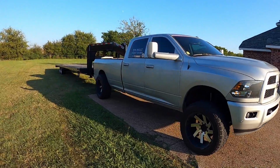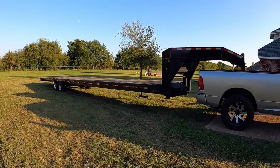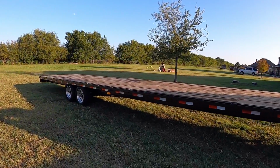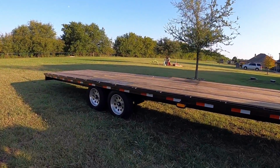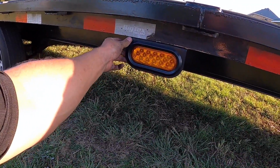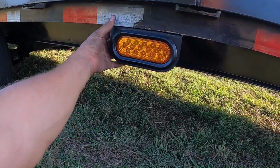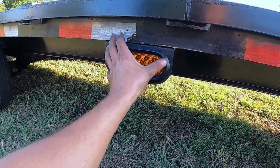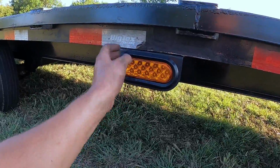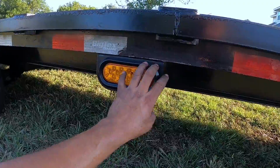Oh, thank God. All right, now I realized, to some of the experts out there, this might not be an accomplishment, right? But I just literally rewired my whole trailer, front to back, brakes, lights, and everything. I fixed some of the little things, like on this side, it had this good bracket, but it was just with self tappers, and I just put nice bolts that won't unscrew, so that's awesome. On the other side, it was just a welded one, not this nice little L-shaped bracket, so I just totally removed the welded one and I put the same one as this thing.